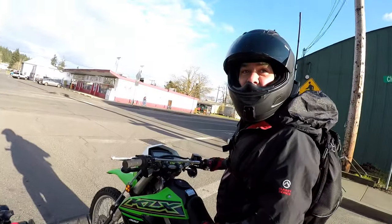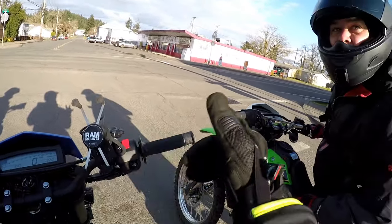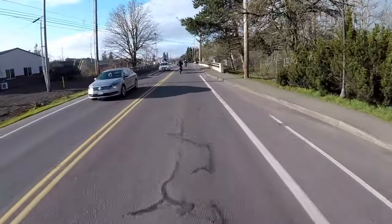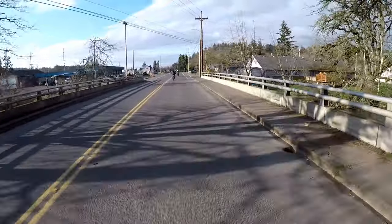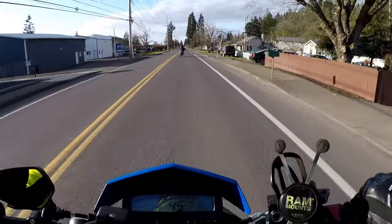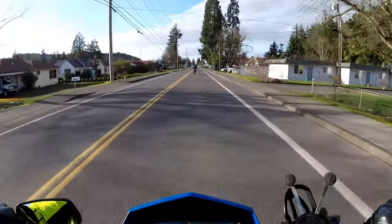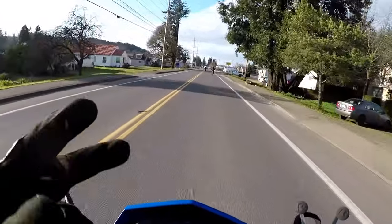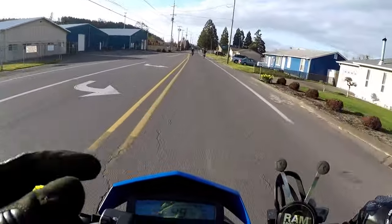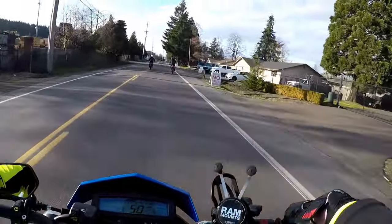That's pretty sick. And this definitely has some stiffer suspension than the Dual Sport for the road — this thing is way stiffer than the 300 Dual Sport. In terms of specs, the Supermoto has 1 inch less suspension travel at each end: 9.1 inches in the front, 8.1 in the rear. If you put a dirt setup on this, you'll have a little bit less ground clearance than the Dual Sport.